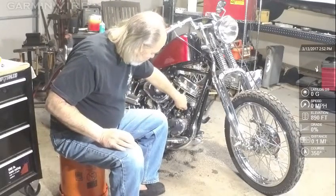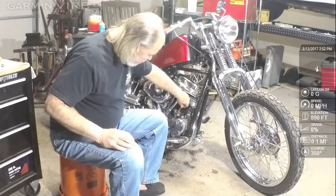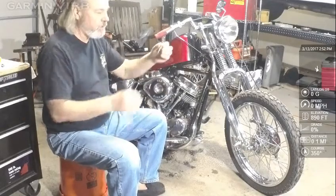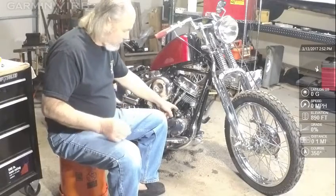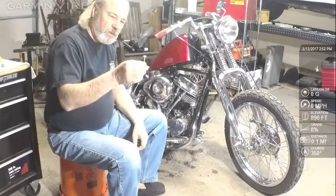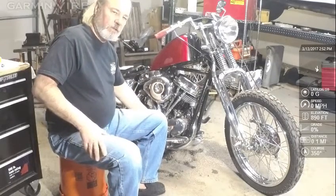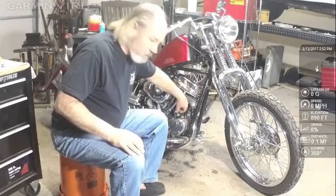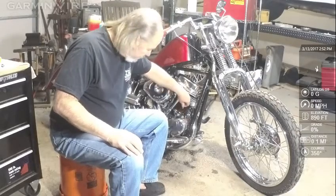The next part is that there's a bolt that holds the cam in. The bolt is tight, so you'll need, I think this is a 9/16 wrench. That comes right out. On some of these, the cam is held in place by a clip instead of a bolt. I have no preference. I don't even know. I've never even looked at the other kind. But they probably work the same. Then the cam slides right off the shaft.